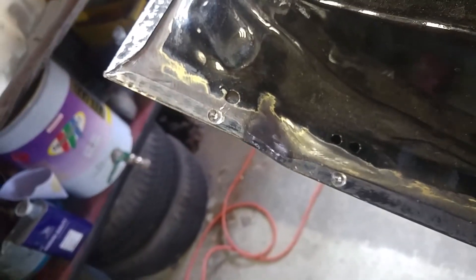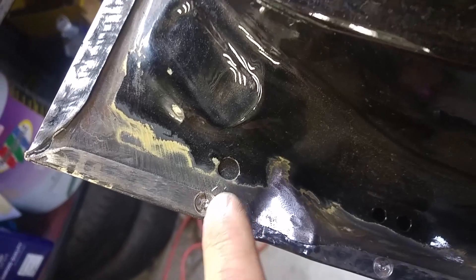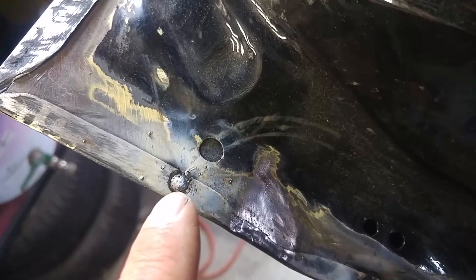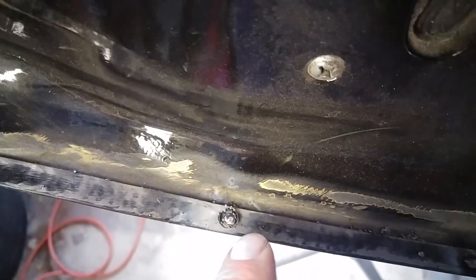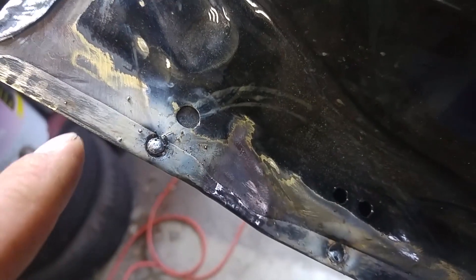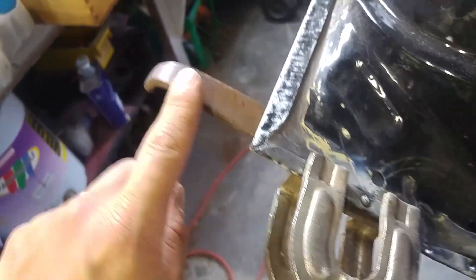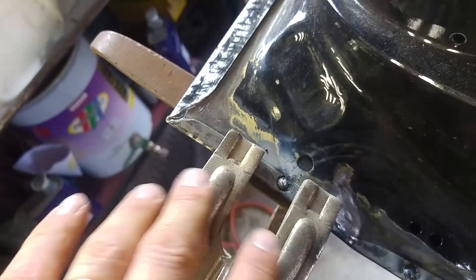I trial fitted the door on the car and it was better than I expected. I hammered the lip over. I've used a spot weld drill bit to take the inside of the skin out and I'm going to fill that with weld. I've put a spot on the door frame, then moved on to do the same in other places, letting it cool before joining the spot to the skin.